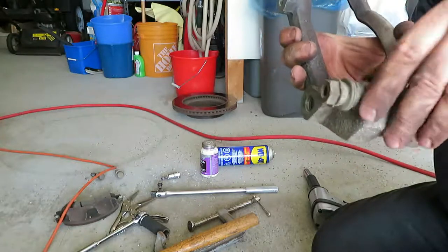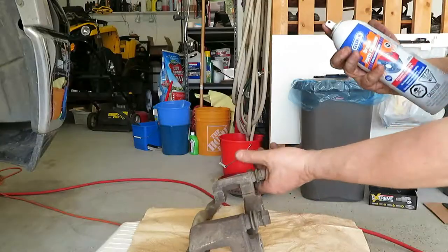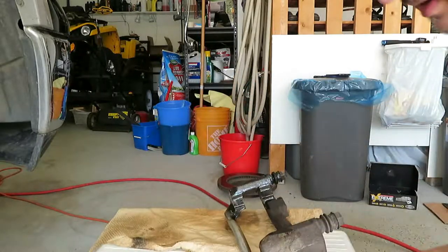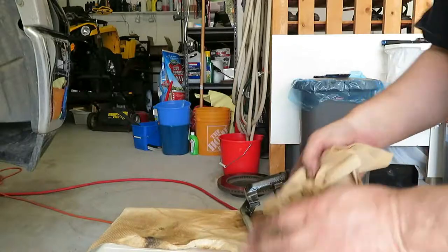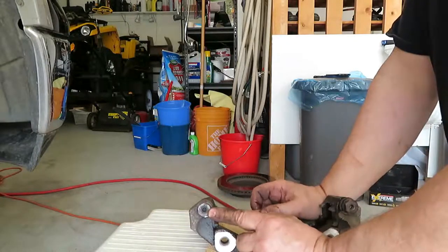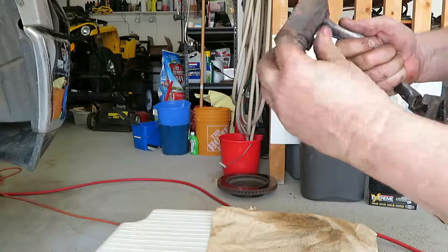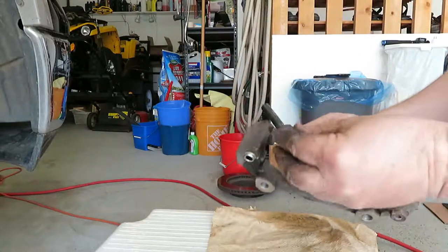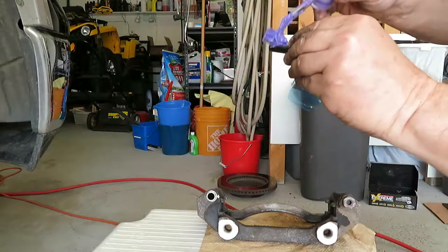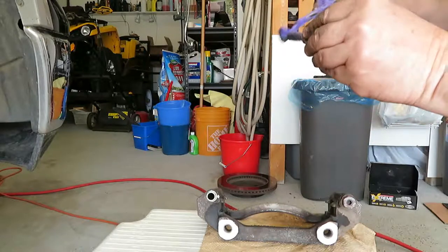Now I'm going to put the same lubricant in those notches that I put on the back of the rotors, for those pads to slide through. Then I'm going to pull out the mounting pins and lubricate them with the same stuff. I'll spray some brake cleaner in the guides to make sure they're good and clean. These pins are pretty easy to take off — all you've got to do is peel the rubber boot from around the post where it meets, and then they pop right out. These are pretty clean so I'm just going to put some lube on there, because this helps the caliper slide back and forth as the brake pads wear out.